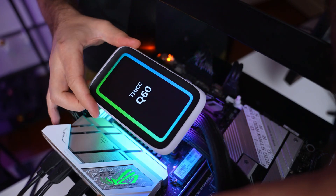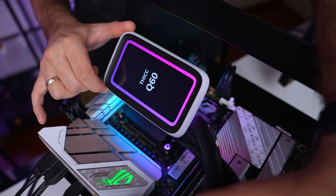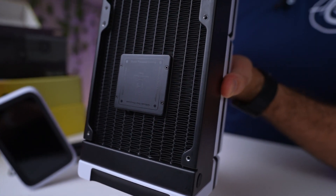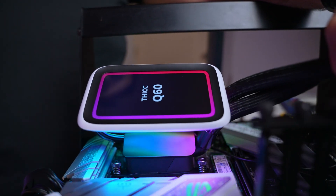There are also some notable downsides. First, the screen orientation is limited — it can only be installed vertically with no real adjustment besides 45-degree turns, and there seems to be no software option to flip the screen, which would be handy for different mounting setups. Hopefully Hyte can address this in future updates. I also encountered a more critical issue: while running Prime 95, the PC began to lag, causing the connection to the control unit to drop. The fan speed settings stopped functioning and fans reverted to the internal speed profile, initially at 2200 RPM before gradually increasing. This happened multiple times — at this price point I'd expect settings to be saved to internal memory and operate independently of the software.